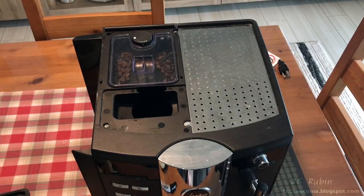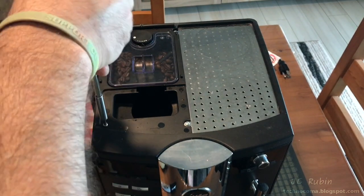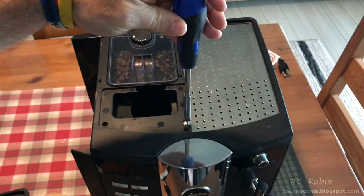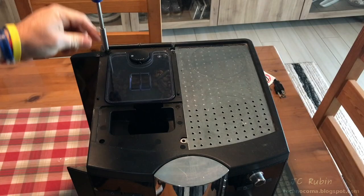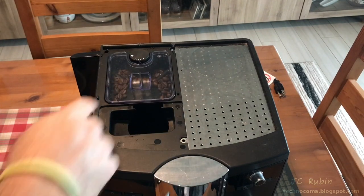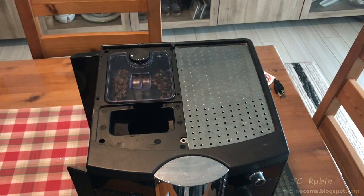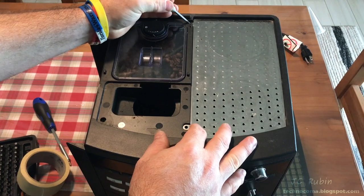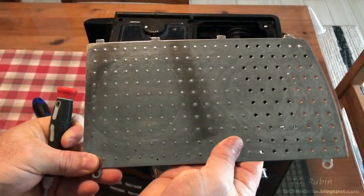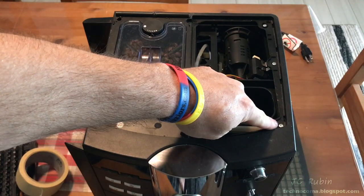Looking from overhead up top, we see number three on the front left-hand side. Then number four, number five here on the back left, and number six here on the back right. With a small flat head I'll get a grip on what they call the heating tray — I just call it the storage tray — lift it up, remove it, and put it into storage with the rest of the removed parts. Now we have three more screws revealed, starting with the front at number seven.